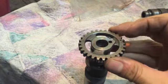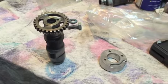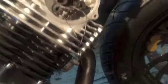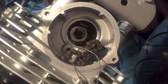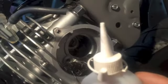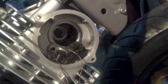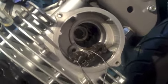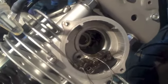That will go on there, and putting that on first it will go back in the top of the engine. So here's the head it's got to go back into. I'm going to put a drop of lubricating oil on the camshaft before I insert it so it'll be free moving. I'll put the cam chain on and I'll have to set the timing up.